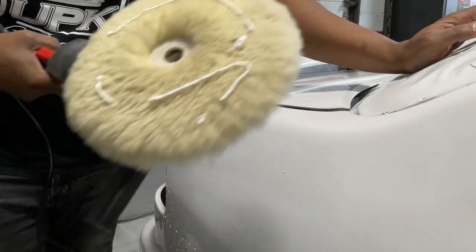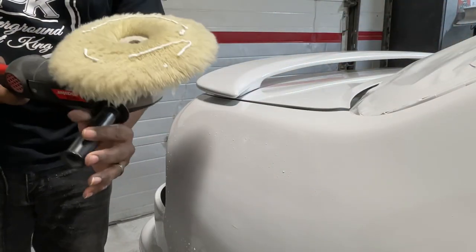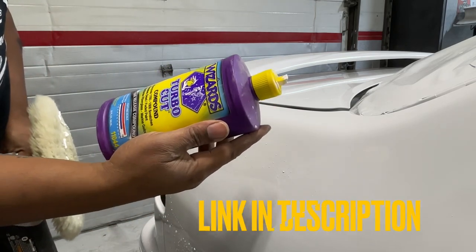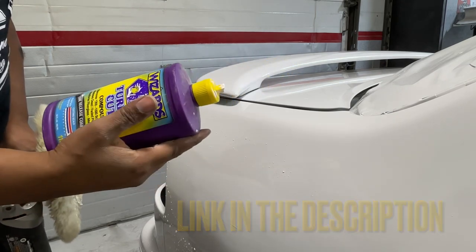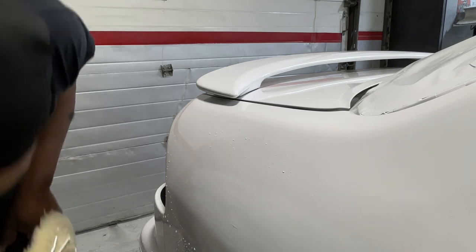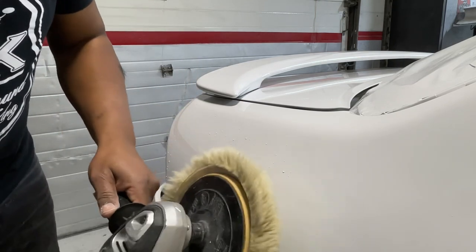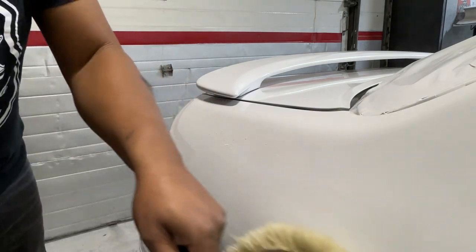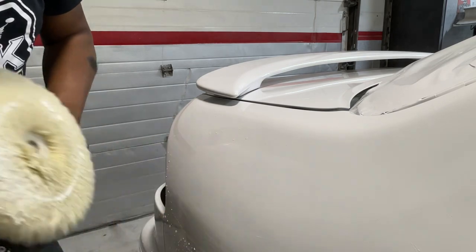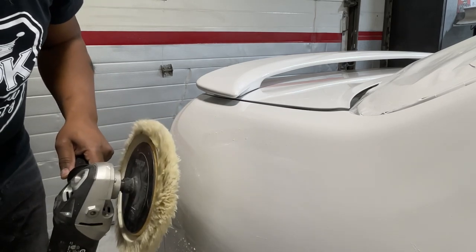Alright, got it where I wanted it. I've got my buffer here — it's just an old polisher from Harbor Freight. I normally use my Makita, but my Makita is not acting right, so we're going to go with the Harbor Freight special. I've got some Wizards Turbo Cut, which removes 1200 to 1500 scratches. And of course I showed you that we're using 1500 sandpaper, so we're going to go with this compound to wheel this section back out. I have some compound on the wheel already — going to work it in on the panel as well as the pad, which is a wool pad. Let's get it going and start working this thing up.